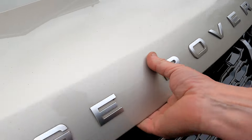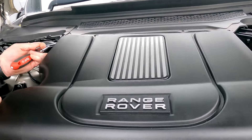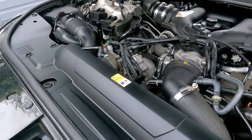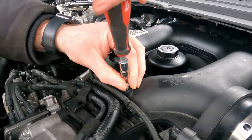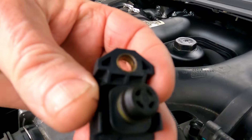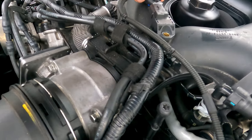Right, back to this one — open the hood and we'll take this off, the little rubber away at the back. There's the MAP sensor right there. So we'll take this connector off, take that one off. See what this one looks like — it'll probably look like brand new. No soot on that — that looks like it's just been cleaned. It has been cleaned, but somebody didn't clean it right, and obviously I wasn't here to blame so I'll have to take the wrap myself for that. Right, put that wee screw in there.